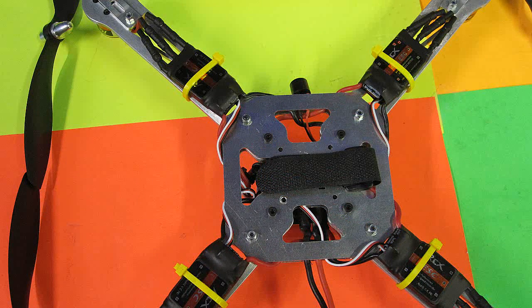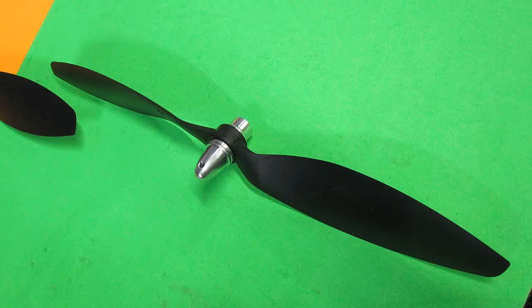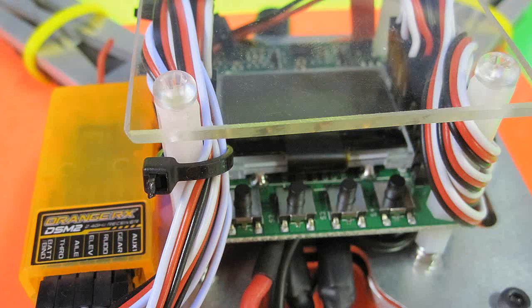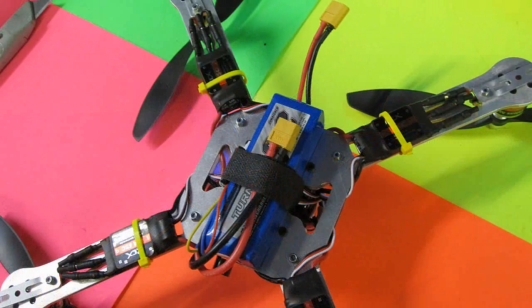Anyway, by getting it from Bryan, who will actually custom build any frame type quad for you, he sent me his custom built one with the latest firmware flash from Simon K for the ESCs, and also the latest firmware for the KK version 2 board, which adds auto level function to the fifth channel. All that flashing and firmware setting up and testing was well worth it to me to have Bryan's Flyin do it. This thing looks indestructible and heavy, but since the motors and ESCs are both from myrcmart.com, it only costs $10 each. So if you ever damage one, the parts are very inexpensive.